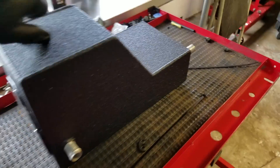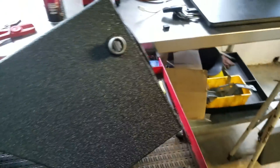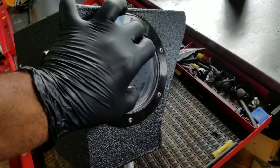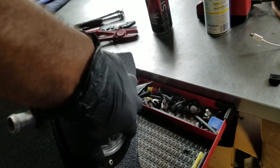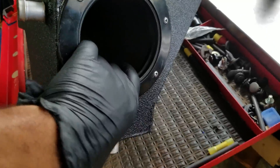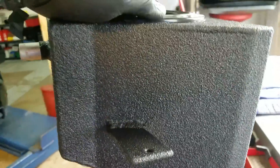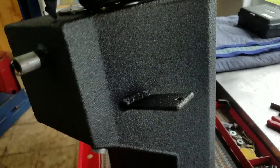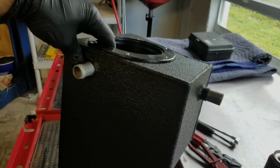Here's the ice tank — we have these at VMP. Basically this is going to take the place of what's going on there, and I'm just going to run water through it. Makes it super convenient and easy to get ice in and out. The drain is strategically set up so it doesn't totally drain the tank — it drains enough so you still have plenty of water. You stuff it with about 10 pounds of ice and basically have a miniature ice tank using the stock intercooler pump that comes with a VMP kit or a Roush supercharged vehicle.